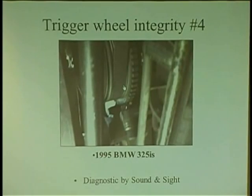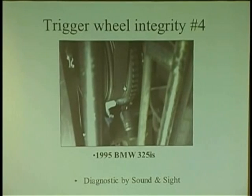John, what about a car where they put the donut on the car, right? The wheel size is different than the other three. What about that? Oh, dude, I got burned on that. I was so anal looking at wheel speed, checking the resistance of the sensor, the air gaps. So I said to my friend, dude, let me know what you think about it. He goes, John, did you know that the front tires are different than the rear tires? I'm like, no way, dude. He goes, oh, way. I never even checked the tires. Never once did I check the tires.